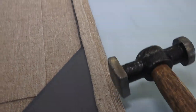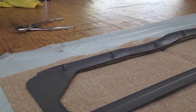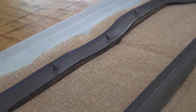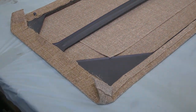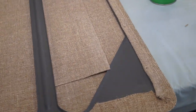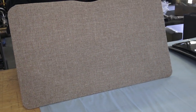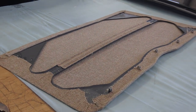Once you insert the bow through that double layer, get a hammer and bang the spikes inward to keep that portion down. Go to the opposite side — the frame — and glue it over the door-panel-style clips that should be on your slider. For the corners, tuck and pull to get a nice finished round edge. You don't want to show any folds on the opposite side, so if there's a little too much material just cut it away. Tweed stretches really nicely for a clean finished look.